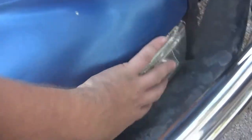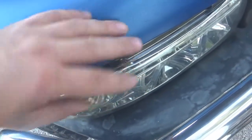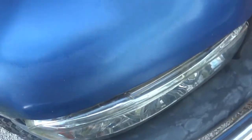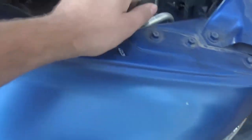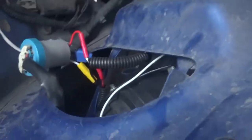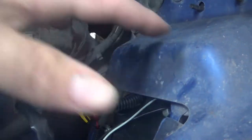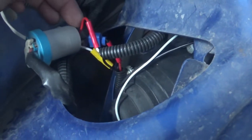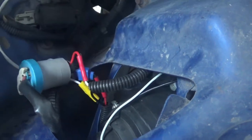For the LED, I ended up taking all the positives and routing them to one of the wires on the parking light — not the turn signal, that was the parking part of the light. It's probably been a good year I've had these on here. If you're looking to rewire one of these, that is how you want to do it: red to white, black to red, white to black — that gets your high beam and low beam. Give yourself enough room off the back of the plug and enough room to splice them together right.